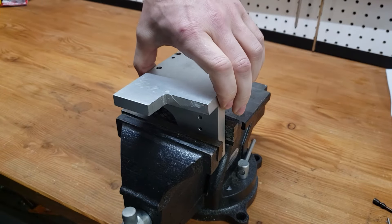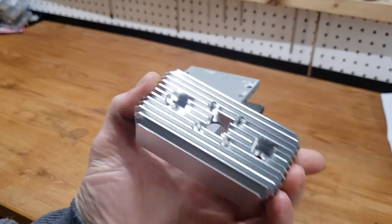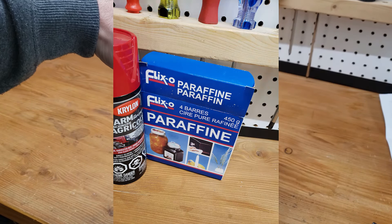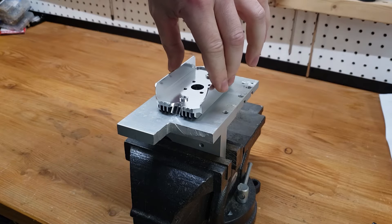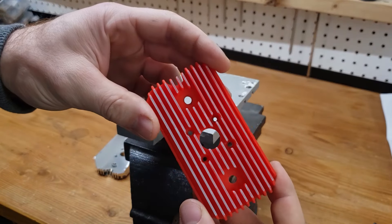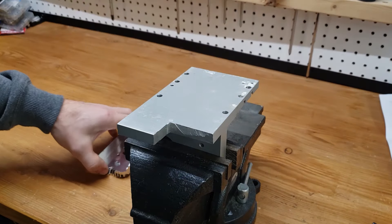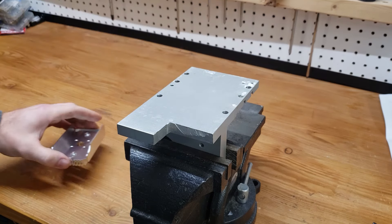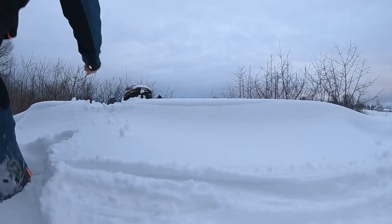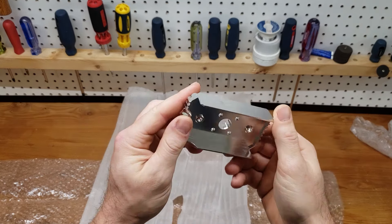To solve the issue, the only thing I have to do is paint it and expose some of it. But what's the best way to mask off the areas I don't want the paint on? I came up with a pretty sick solution: I'm going to use wax, or paraffin to be more precise. I will apply a thin coat on top of the fins, and when the paint is dried all I have to do is remove that wax coating and expose the anodized aluminum underneath. The paint insulating the aluminum shouldn't be an issue since we're running in winter and snow will keep it cool, and I will not be painting the underside of the heat sink to leave it exposed for better heat dissipation.